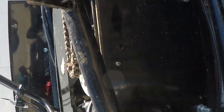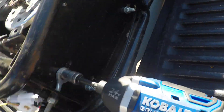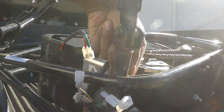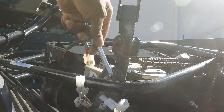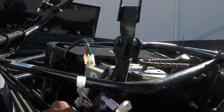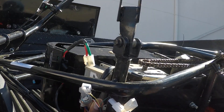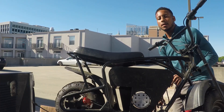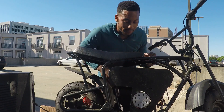I had an impact gun so I was able to make really quick work of this - just blast each of the four corners and you're all set. The whole unit should just fall out. After that's complete, stand the bike up and lift the entire thing out. Make sure all of your wires are disconnected and you'll have a clean frame.